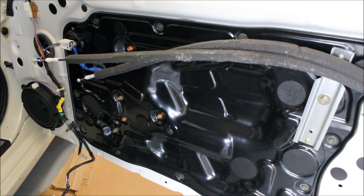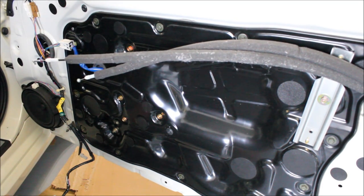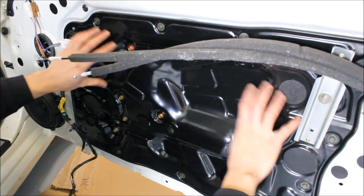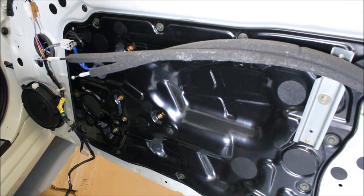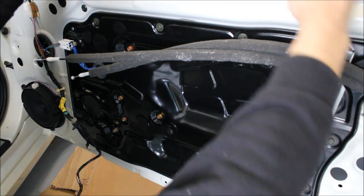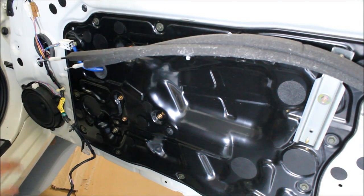Someone wanted me to do a video on taking apart the power windows, but unfortunately it's just a lot of work. I will give you a couple of tips though. You'd remove all the perimeter bolts first — that's for the outer skin. There are three over here for the motor, and the gold ones are for the window regulator. The tip is to have the window up and clamp it, because when you release a lot of the stuff the window's going to want to come down. Duct tape it and clamp it to hold the window up, then remove the panel. There's a big adhesive strip all the way around — you'll have to really work it out with a pry tool even after getting all the bolts out.